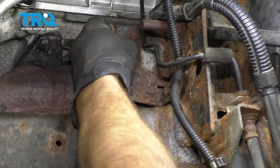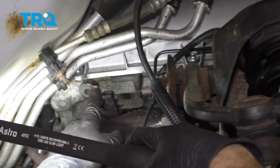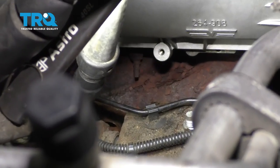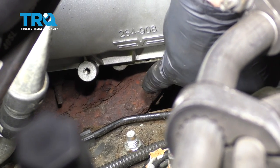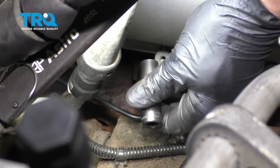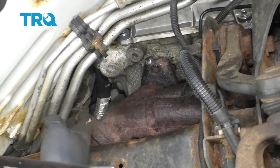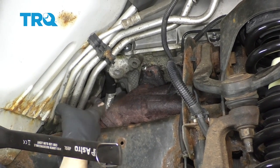What we're gonna have to do to access these a little bit easier is to remove this bolt right here, which screws into the shock tower, and then we'll be able to remove this shield. Our shield is actually broken, so essentially remove the bolt, give this a little wiggle, and get this out of the way. At this point, I'm gonna continue on by removing the nuts and the studs of the ones that I can see. To get the forward bolts, I'm gonna come right up inside the hood area here, and I have a nice view of where one of the studs is right there. The other one should be approximately right here, but this one is broken inside the engine, which is gonna be a nightmare. Essentially, we're gonna use our little twist socket and use a pry bar to force it on there and then try to get it out.